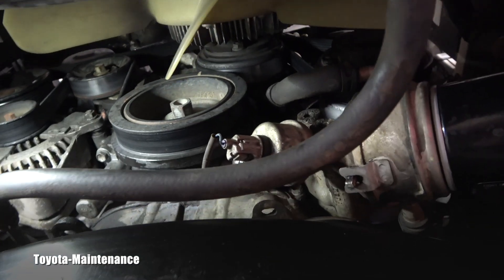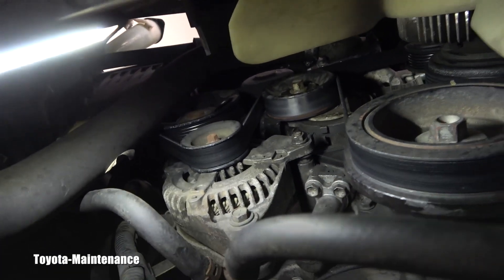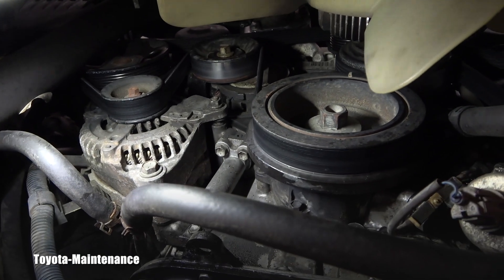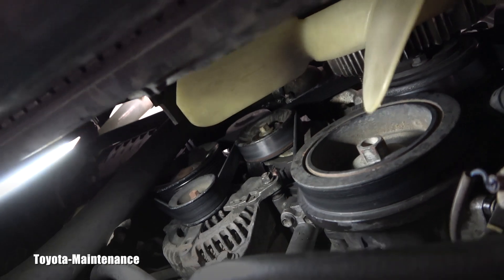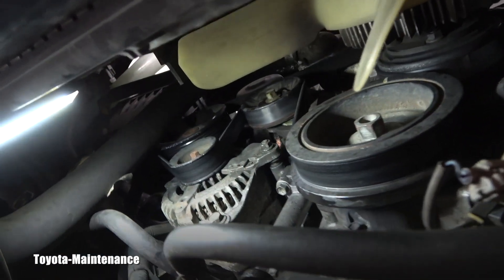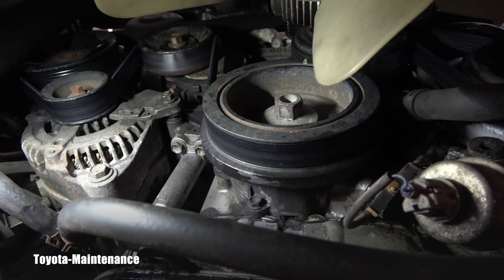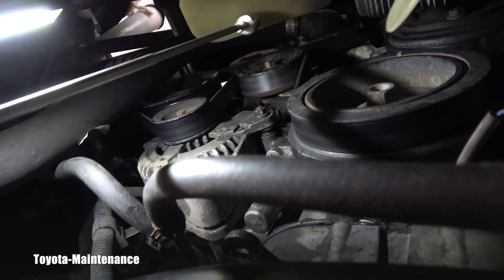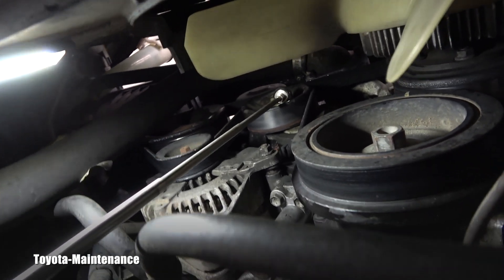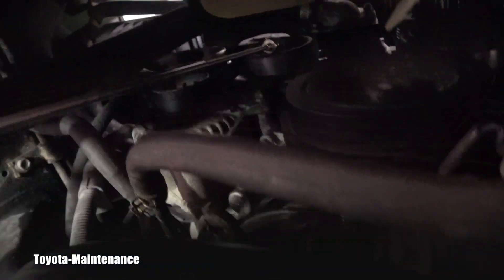Of course, you're also wondering what that horrible squeak is. I have a subscriber who works right around the corner — when I was coming here I asked him: what is squeaking? Give me your diagnosis. His idea was that it's possibly the belt, and that's close — it's actually the belt tensioner. I'm touching it for you and putting the light on it.